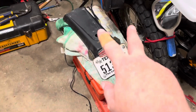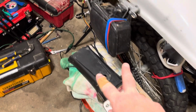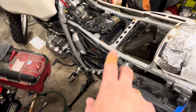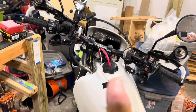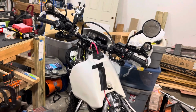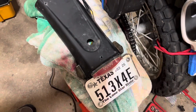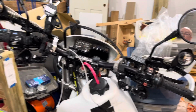And I'm wondering if something happened here, maybe a short, and I plugged in those turn signals and then maybe knocked out the turn signal relay. So might have to start over again with brand new mini turn signal lights and maybe a new turn signal relay.